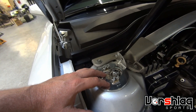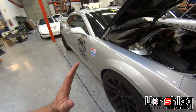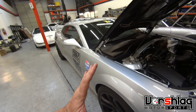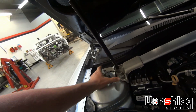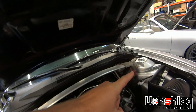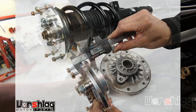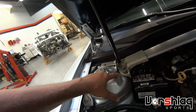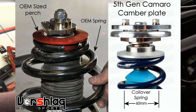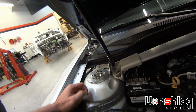The actual camber adjustment you will get depends on your total ride height, and as the car gets lower, every setting on that plate will be more negative. They made some changes to the strut tower to accommodate the strut tower brace, and both towers have the same indentation. That made it a little bit trickier for us — we're trying to keep the stack-up height of the camber plate as short as possible. Our camber plate and spring perch for the OEM spring, which is a much bigger diameter spring, can run into this dimple in the tower as it goes more inboard.